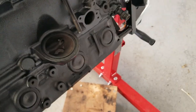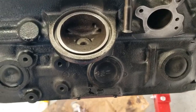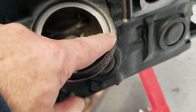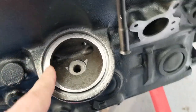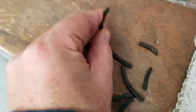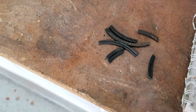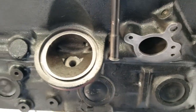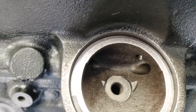I'm gonna go ahead and start cleaning off some paint - we're gonna repaint this anyway, a different color, kind of a dove gray. Those have to be cleaned off. All nice and cleaned up. One note: in this groove at the bottom where the oil filter would normally be seated, and here where the distributor gets connected, there was a remnant of what should have been a pliable piece of rubber. You can see it had a big crack in it - there's no way that's gonna seal anything. Quite likely that piece of rubber was damaged when the engine was heat and pressure washed, or killed in the dip. But that's a lot better now and we'll have a good seal when we get the oil filter back on.